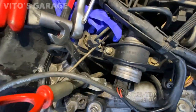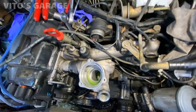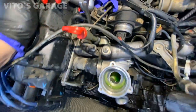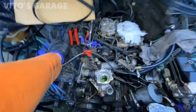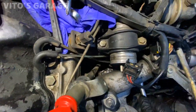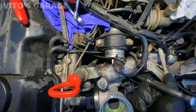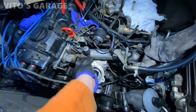The hardest bolt is the top right one. I loosened the dipstick, found another 13-millimeter bolt, moved the bracket out of the way, positioned the wrench on that bolt, and the water pump is almost out. It was a big pain with that bolt but I used a swivel socket to slowly work it out. A lot more coolant just came out.